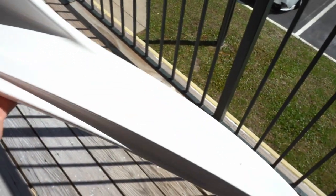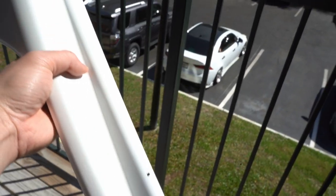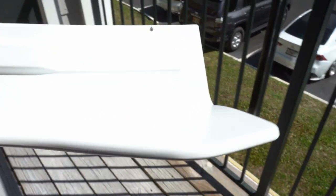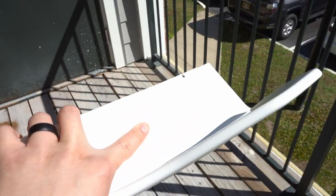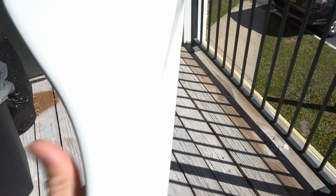This is how it looks in the sun before we start wet sanding. It's been about a week — maybe six days — since I painted it. It's kind of hard to see in the white but it's definitely not perfect. We're going to follow Paint Society's cut and buff instructions. They recommend a 2000 grit, then a 3000 grit wet sand, then 8000 grit to finish, and then polish.